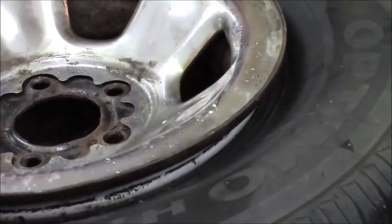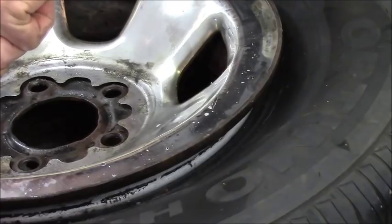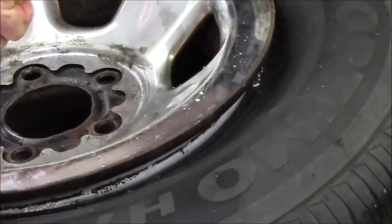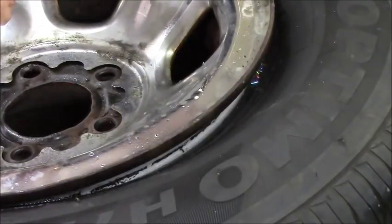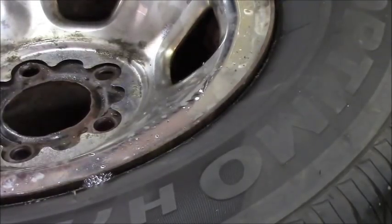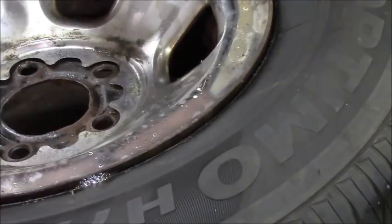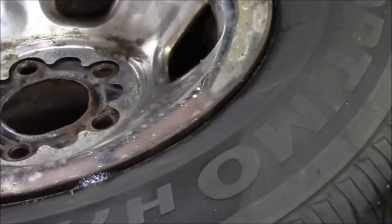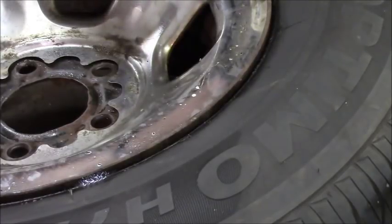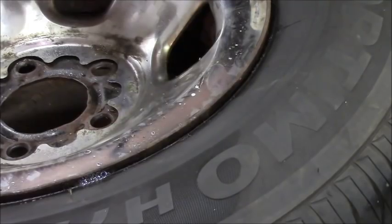We'll just raise it up on here - the bottom bead is still caught. I didn't take the valve out of this one. Off to the tire store to get these balanced up correctly. I found out with the pulse in my van brakes - it had just been sitting too long and the cast iron shoes had made big rust patches on the front rotors. So I'm just going to go after them with my little orbital sander and clean off what I can on the front. I'll stick some sandpaper in my fingers and rock it around - I think it'll wear off just fine.